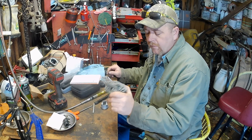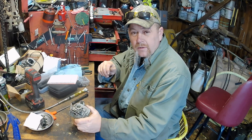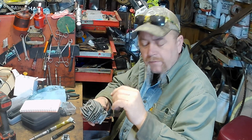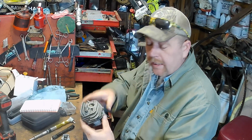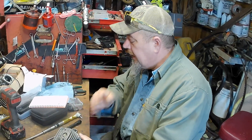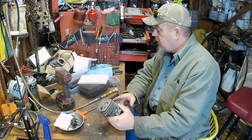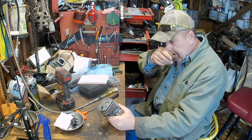Okay, took it apart. Before I took it apart I timed it with the sealer in it. I went about timing just a little bit different — if the numbers aren't exactly the same, I started using a piece of 35-thousandths MIG wire as a stop. That takes the arbitrary out of how much first ray of light I have. I just decided to use 35-thousandths MIG wire as standard. Readings came out: 96 and a half degrees exhaust, 123 degrees on the starter side transfers, 123 and a half degrees on the clutch side — half a degree off. 70 and a half on the intake, so 141 total.